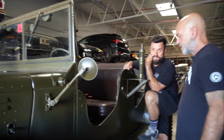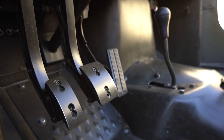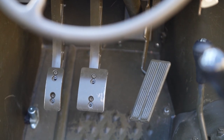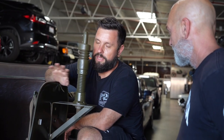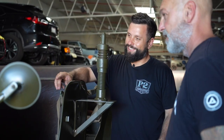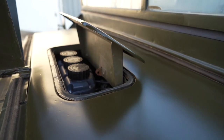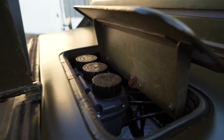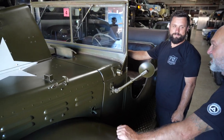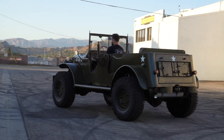We're particular about speccing brakes and making sure the right stuff is there for the clutch and feel. Part of every build now is putting a tilt pedal box in it. We have manual brakes — the master is actually hidden. I hate seeing masters on a firewall; it always looks ugly. So we hid it under the dash with a pedal box — the masters are attached to the pedals, and the reservoirs are right where the vents used to be for the cabin. That's really smart repurposing — brake and clutch reservoirs, easy access.